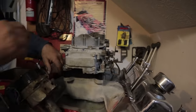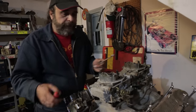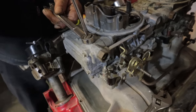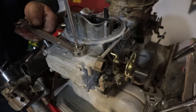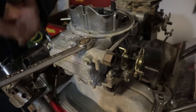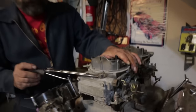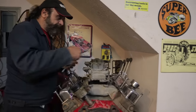The way you adjust it: loosen the jam screw — some fuel is going to leak out when you do this, so go easy and keep the relationship between the nut and screw tight. By turning the nut counterclockwise, you're raising the level of the float. By turning it clockwise, you're lowering it. Balance this out until you get to the point where, when gently rocking, the fuel just barely trickles out the bottom of the sight plug. At that point your fuel level is set. Then go ahead and do the same to the secondary bowl.